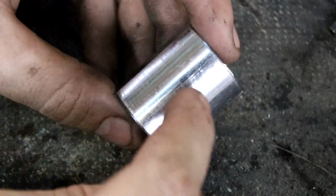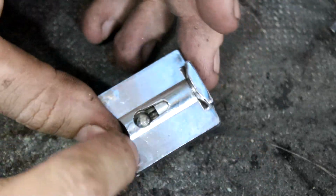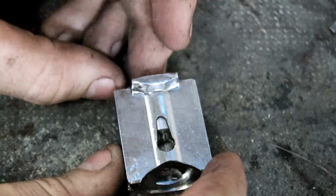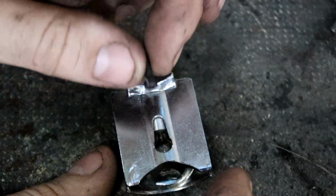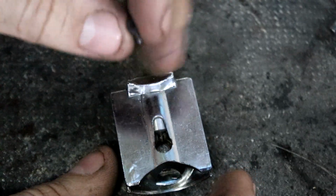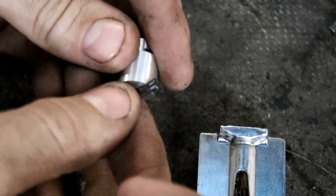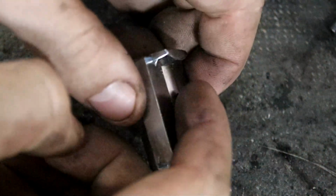So what I was planning to do was drill a hole through it. But what I think I'm going to do now is, because you can see part of the little aluminium insert in the old cable slot down here, if I drill a hole for an M3 screw and put the screw in there, that'll stop it from sliding out. The only problem is this screw is too long, so I have to cut it shorter, but the head will still stick up out of here.